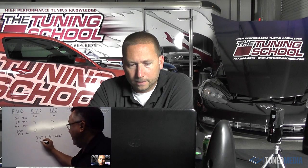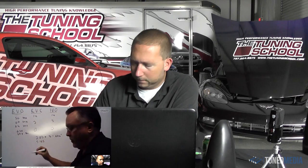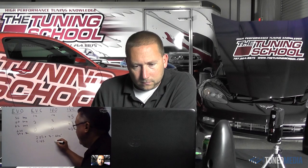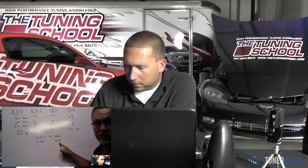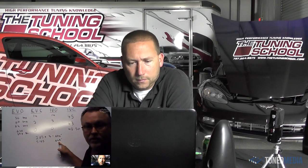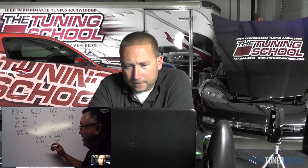Of course, when you've got a big valve, like in an LS3, a 2.165 valve, we're at 649 lift. Now, Brian, how do you get your 0.3? Where did that come from? So this valve diameter to lift ratio number is just something that was learned with time.